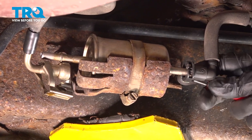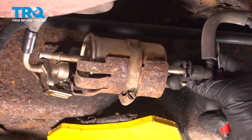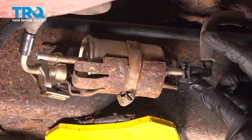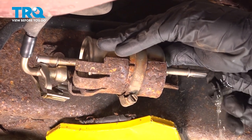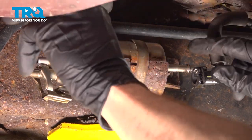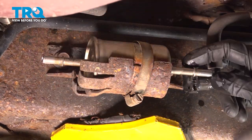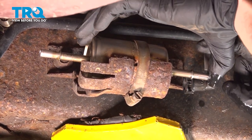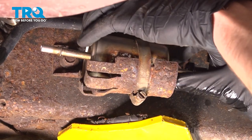Come in from the back side and carefully remove that locking clip. Continue on by removing the other side of the fuel line. Set those hoses aside. Now grab onto the fuel filter — it's a good idea to put your glove finger over the end so no fuel comes pouring out — and slide it up and out diagonally towards the front.